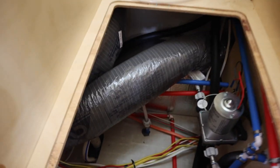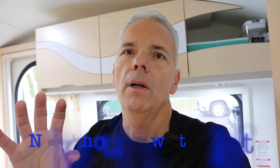What that means at the end is that next season you're going to have to flush and clean all that stuff out. I don't want to fill the whole water system full of antifreeze or vodka, so I opted to go with the air pressure — pushing air through, getting the bulk of the water out. There's still going to be a little bit left, but not enough to freeze and expand to damage the plumbing or fixtures. I don't want to have to flush everything out and worry about getting that antifreeze out — one less thing to do when it comes time to take the trailer out of winterization.